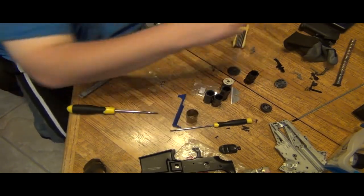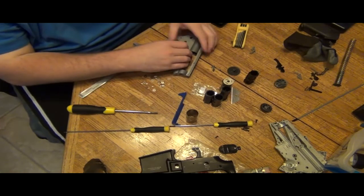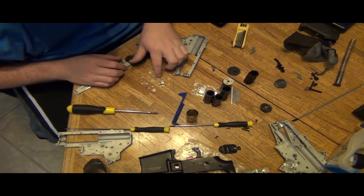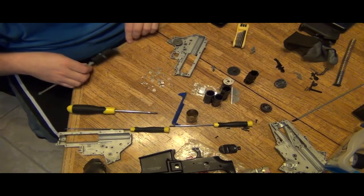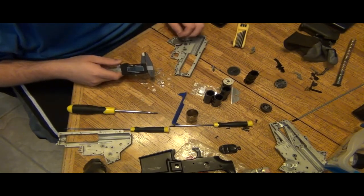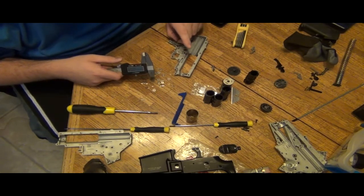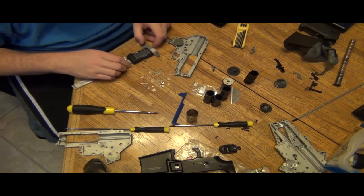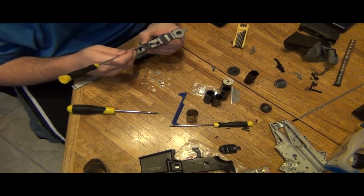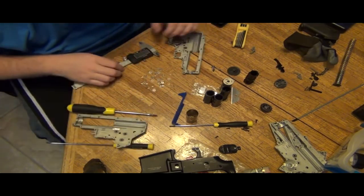Alright, so you see I'm going to grab my tool here and use gravity and push up and down. There's quite a bit of movement. Probably going to try to throw on another heavy one here. This doesn't look like a 0.3, it's not a 0.2. Still think we have a little bit. Yeah, we have a tiny bit, maybe 0.1. Should pretty much clarify it.